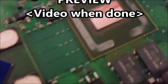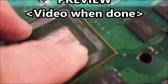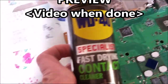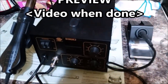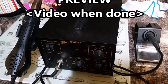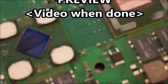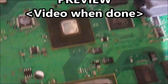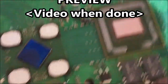I think this one's only got one small scratch on it, which I'm hoping isn't going to cause any problems. You can see the small scratch right about here. What we're going to do now is clean them off with some WD-40 contact cleaner spray, and then we're going to put some heat on them using this cheap solder station with liquid flux. The contact cleaner is on there — just let it sit for a minute or two, then give it a wipe with a piece of tissue and it'll come off clean, then we'll be ready to go.